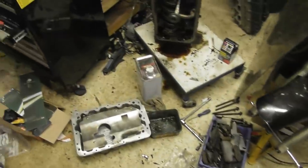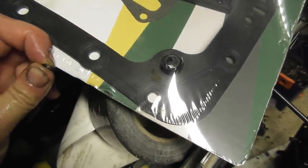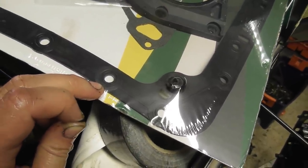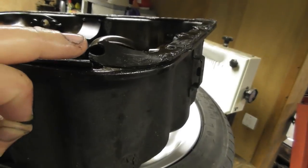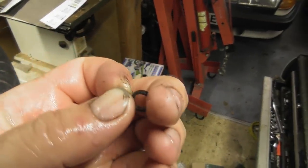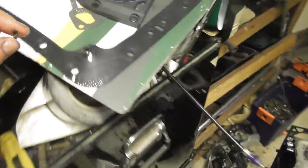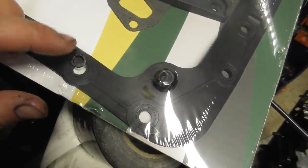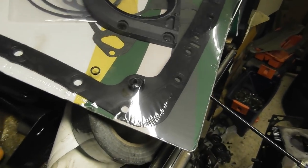I was just looking at this again, trying to work out what bolts to use. They need to be M6 thread, but I'm pretty sure M6 would pull up fine. This is the gasket that came with my new kit, and these holes are definitely M8 clearance type holes. When you look at the old gasket, although that was held in with M6 bolts, I've removed that steel spacer. So what I'm probably going to do is remove all the little steel spacers from the original sump gasket, insert them into here to stabilise that area, and then just use M6 bolts with a big head.